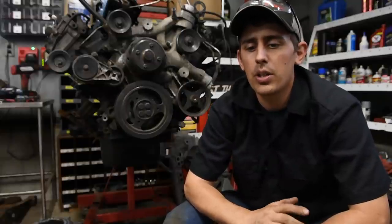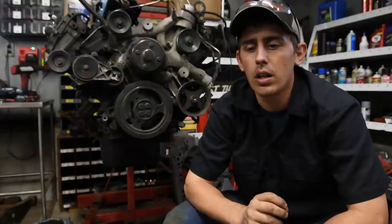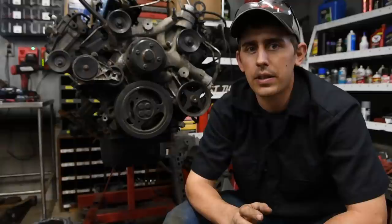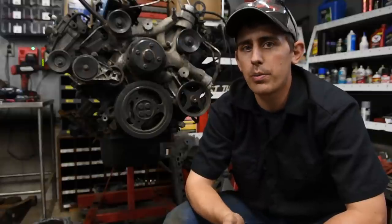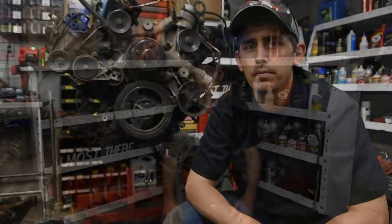So if you are starting to experience the difference in engine oil temperature and engine coolant temperature, you need to really make sure that you follow the cleaning procedure laid out by IPR. I will be making an additional video talking about exactly that, but make sure you follow those instructions and clean the coolant filter properly. You also should be doing a flow test before and after cleaning the filter.